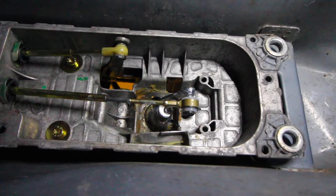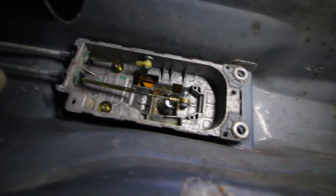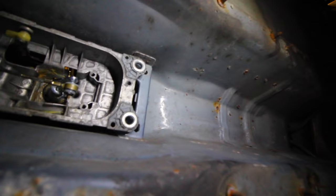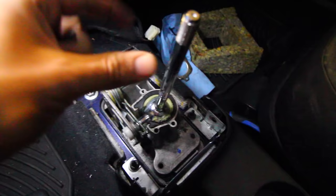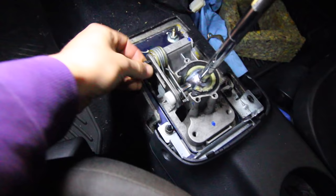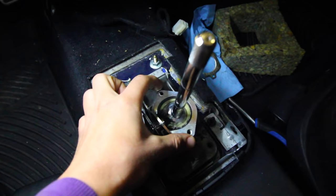With both cables and both new bushings in place, we can put everything back together down here. We mount the bottom plate back over the shifter, reinstall all the aluminum heat shielding found in the tunnel, and then remount the exhaust. Back in the cabin, we secure everything down so the shifter mechanism engages all gears. There's one screw here that needs to be inserted — we tighten that up and then install this piece that goes over top of our shifter, specifically designed for our Mark 4 Golf.